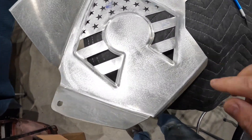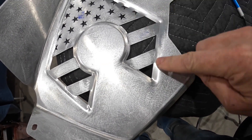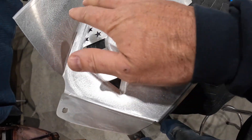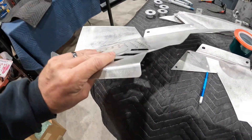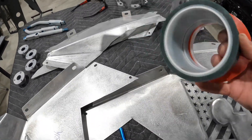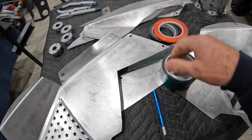We're going to start with the red and tape off the hard lines that we don't want to get near with the vacuum. The rest we can just blow off and vacuum as we go. The back of these inner fenders can be all black — they don't have to be the same color both sides, so that part makes it easy. We've got heat resistant tape and we're going to start laying it down.